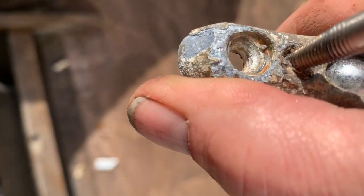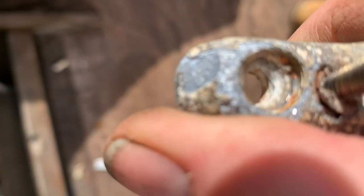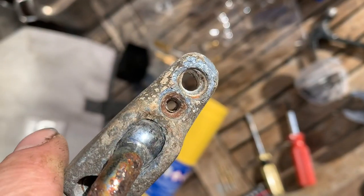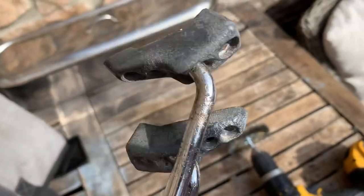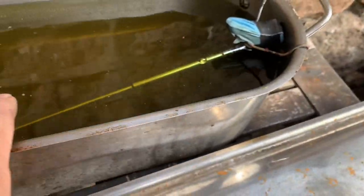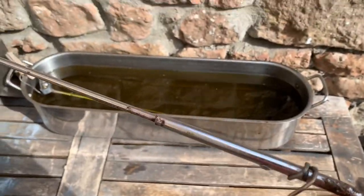If you break one of these easy-outs in that hole you really do have problems. I've just stepped this up to the next easy-out and you can see that screw is starting to come out - at least what's left of it. There's still some screw left in there which we should be able to pick out, and then it's just a matter of re-tapping those threads for your new screw. When you manage to drill out both screws, tidy this up with a wire - just wrap a little bit of wire around that - and that will get most of the rust off. I'll probably paint that with some Bosny chrome or maybe the MRO, and what I don't like doing is painting over rust. The sun visor rails have been sitting in the rust bath for a couple of days.